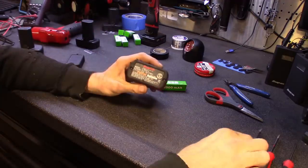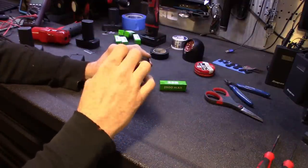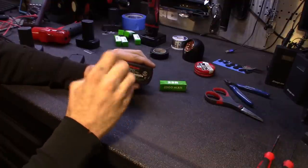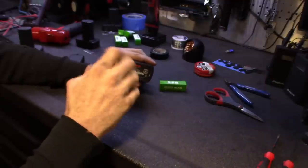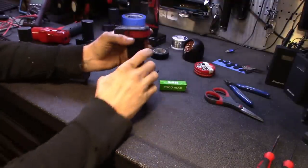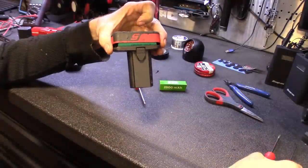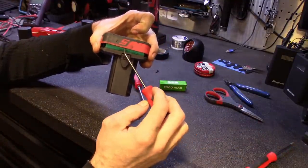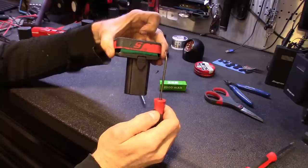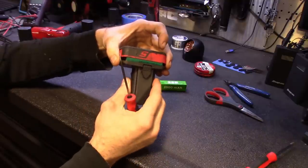They use a T8 Torx at the bottom. I have opened this one before — get the Torx screws out and they've got it glued in. There are two batteries down here and two batteries standing vertical. Work it back and forth to get it pried up, then use a pick or flat blade screwdriver working from the center — not the edge — because you could short these batteries out and the thing gets hot fast. It can blow up in your face or start smoking.